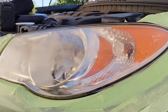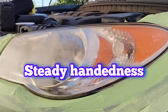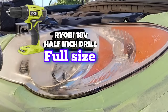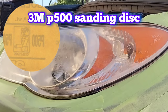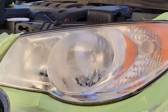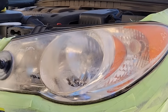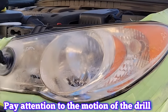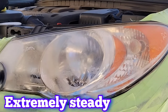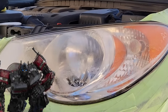It's no big deal. You just have to have a steady hand and kind of finesse it, because you're going to have to dig a lot of this out. You're going to have to go a little bit deeper than you normally would to get that utmost clarity. The best technique you can use on this is pressure control and steady-handedness. The sanding pressure is what you're going to be wanting to control to not dig, to not really gouge out those surfaces.